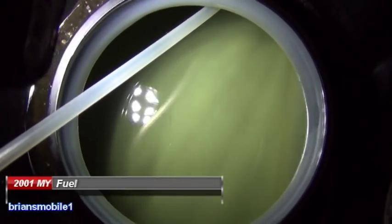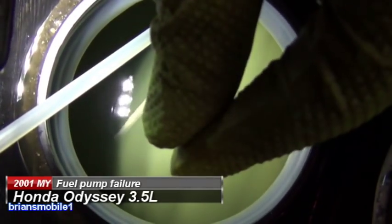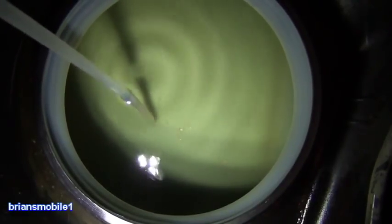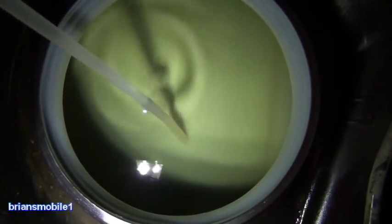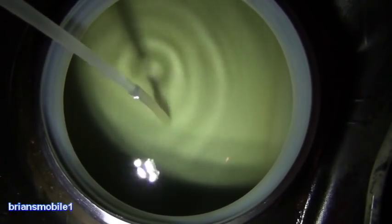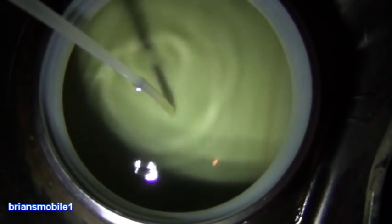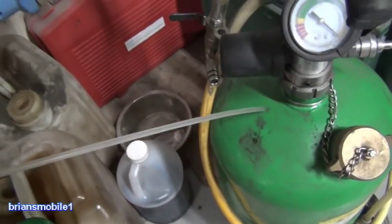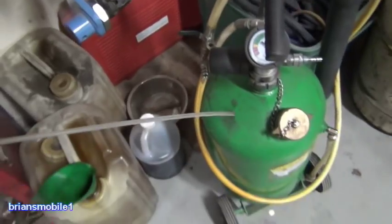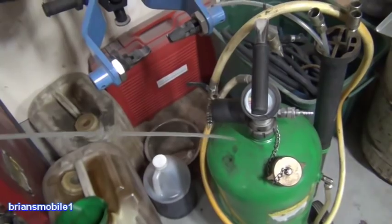As I'm cleaning out this tank, there are little pieces of glitter but they don't show up on camera, so I've got some little pieces of copper wire to drop in there — those should show up. I get this right down on the bottom, hit suck, and it just sucks them up just like that. Then I clear it and you hear it suck and clear all the way through. That's all it takes to get it cleared out — you suck all the contaminants out, turn it off, and you don't have to drain the whole tank but you still get the big chunky junk out.